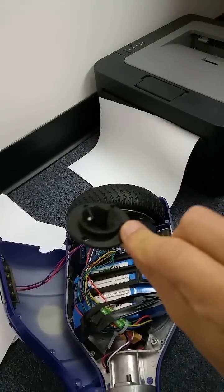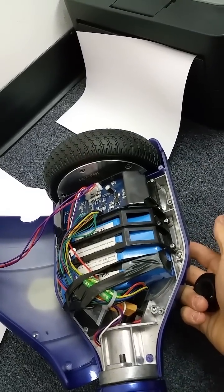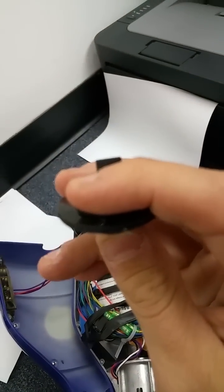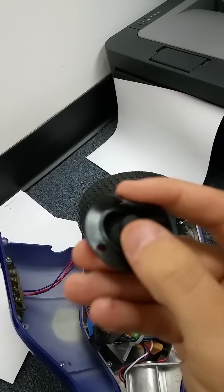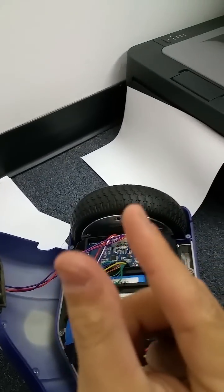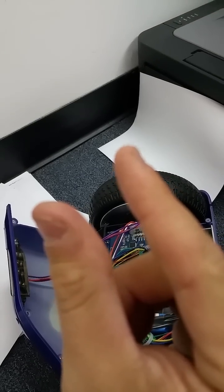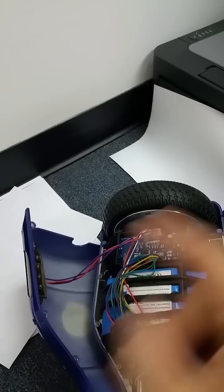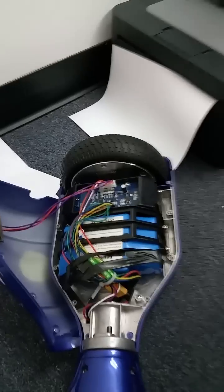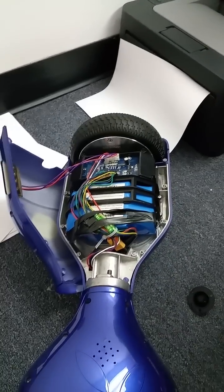This is basically called a nipple. When somebody presses their foot on the rubber below, it pushes this button and causes that nipple to rise. Within the front and the back there are two little wings or sticks, and inside there's an LED light — similar to a garage door opener — where the sensor shines through. When it breaks contact, the board knows when to stop. When you press it, it stops the sensor and knows to go forward or backwards.